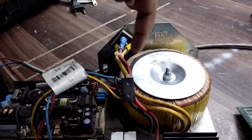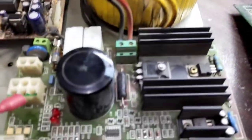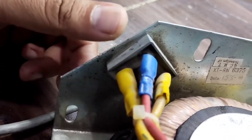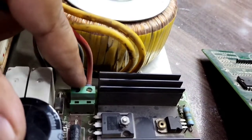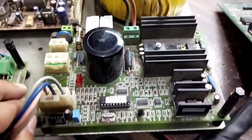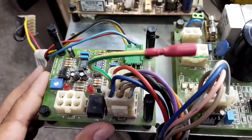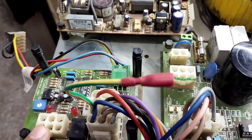This transformer steps down the 220 volts. The AC voltage comes to this board and is converted into DC volts through this bridge rectifier. The converted DC voltages come across these terminals. This board is totally for the incline motor — it drives the 36-volt incline motor. This other card drives the upper console and sends power to it, as well as driving the inverter.